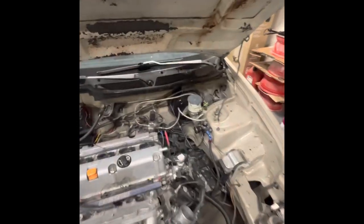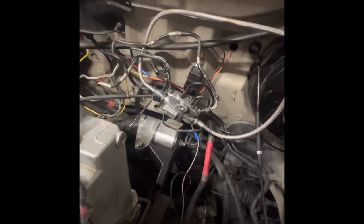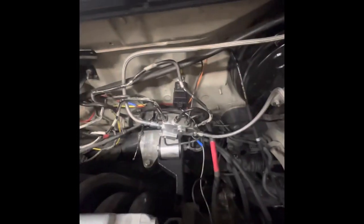So we're gonna keep doing some research, figure out what's going on. I do have one idea. You'll notice right there that brake line is a little burnt. Now the actual shielding on the line isn't melted or anything like that. It didn't get super burnt, but I'm wondering if that was enough to collapse the line and cause these issues that we're getting. But if that was the case, why are all four corners sticking and not just the channels controlled by channel B on the master?